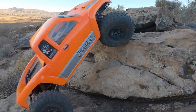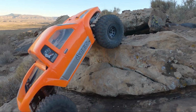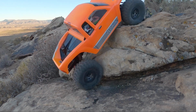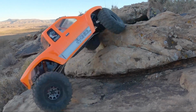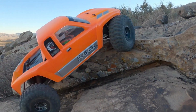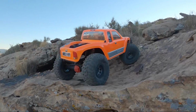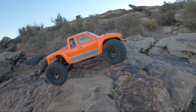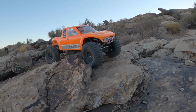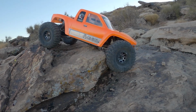Because I've got Axial AR45, so I get the full good steering range and strength of Axial along with the upgradable overdrive and underdrive gears in the differentials there. But then I've got the Element transmission for the smooth, quiet control with the additional overdrive. So I could go up to like 30% overdrive in this truck if I really wanted to. And then the skid works with either transmission, so not a big deal if you put the Axial 3-gear in there, but you can get up to 30% overdrive with Axial axles and Element transmission, so that's why I have that set up in this truck.